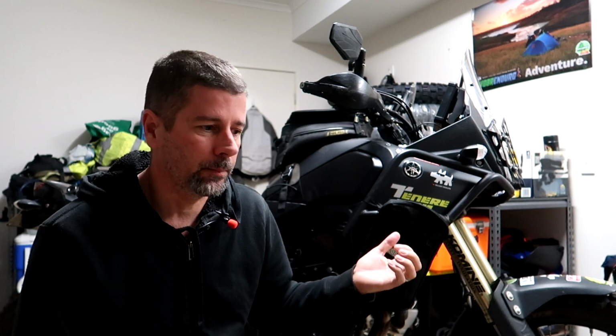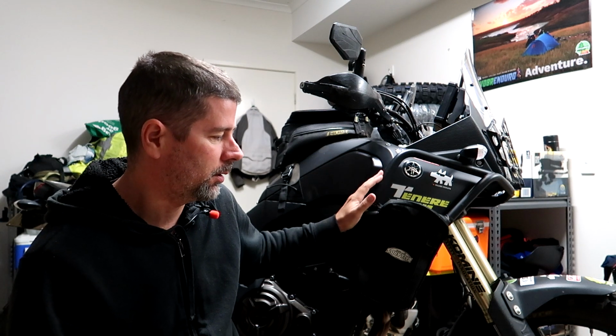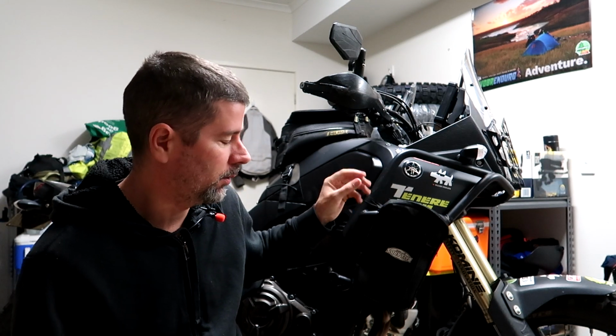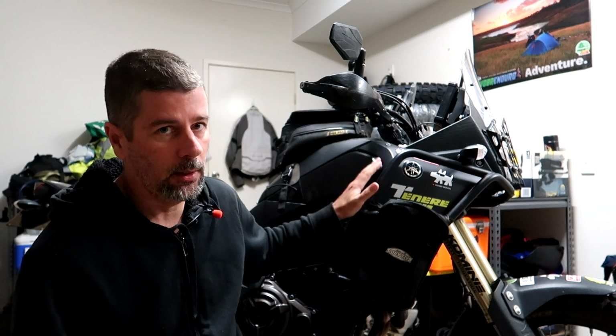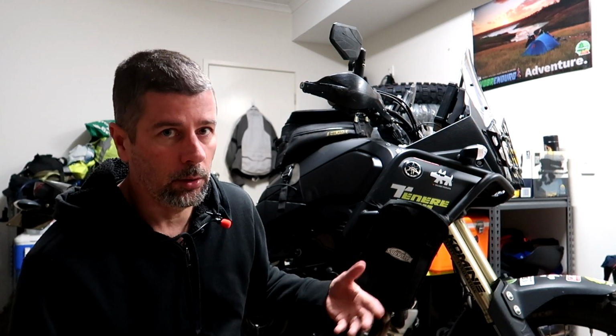So just to basically give you an idea of where to start if you did want to try and do this yourself. One of the good things about doing this is it is relatively cheap and easy to go back to how it was before if you find that you don't like it. So you just have to buy some 10 weight oil and change it back out. As I touched on earlier, this bike had about 12,000 Ks on it when I actually changed the oil out in it. The oil actually came out pretty clean. It's some weird white looking fork oil, but anyway, it was clean, and it now has 16,000 Ks on it. So yeah, 4,000 Ks on that 15 weight oil, and it's been fine. So good to change the oil out regularly anyway. So you know, it's a win-win.